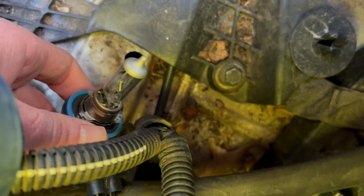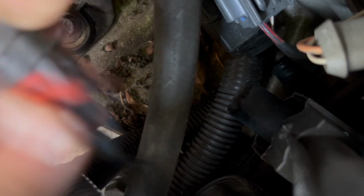Again, hard to see when you're looking, but it's this cap here. It's a rubber cap. Take the rubber cap off. We rotate counterclockwise and give it a nice pull, and it popped out. Tabs, just like that. So again, an H11, link in the description below.